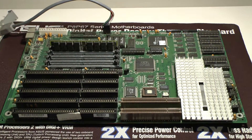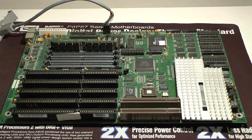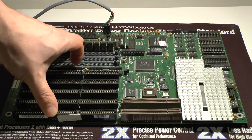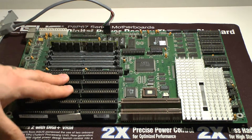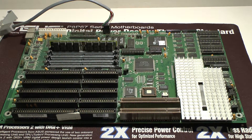The only downside of this board is it takes a long time to boot past the first screen. If you've got 4MB of RAM it's fairly quick — it'll detect the memory, test it, and boot Windows. But if you have more than 4MB — say 16, 32, or 64 — it tends to take an age. 64MB is lovely on these machines. They are a beautiful, very well put-together board.